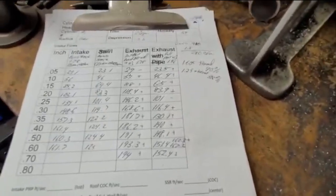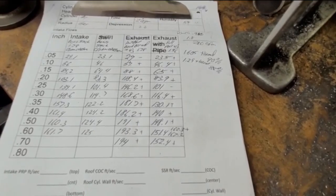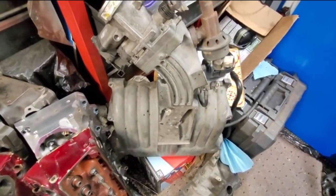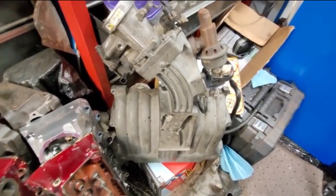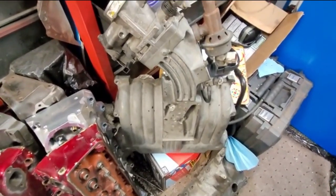I'm not talking about running it through that disaster intake yet — just wait until I show you the flows on that, it will make you cry. Jeffrey said this 95 throttle body doesn't flow as well as the older ones that have that curved neck. I thought these newer ones flowed better, but the GT intake I have was cut in half and ported. This is completely stock stuff, so I'm going to do some flow work with it completely stock, though I don't think I'll saw it in half.